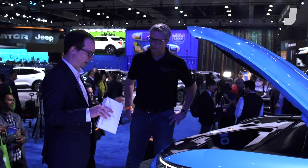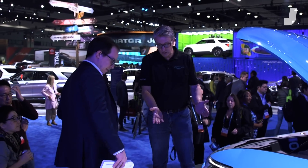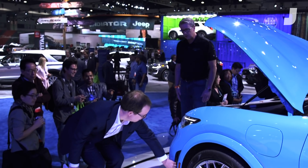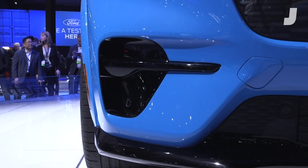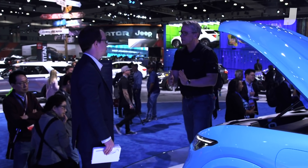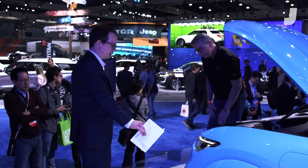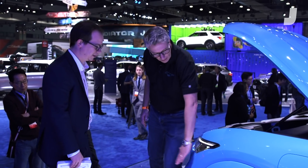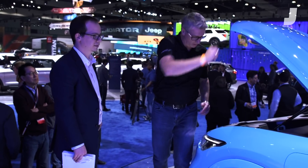While we're at the front, there are a couple of aerodynamic things I'd like to discuss. This happens to be a GT, so we have an air curtain going through. On the base car, we've styled it a little less aggressively, but the air really does attach to the front corner and stay attached — we've done a lot of work to keep it attached. You want to make sure you're not getting turbulence, and you want to keep that airflow attached to the side of the car coming over the hood and over the top.